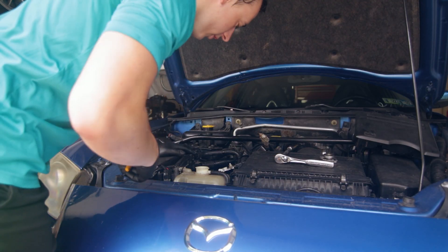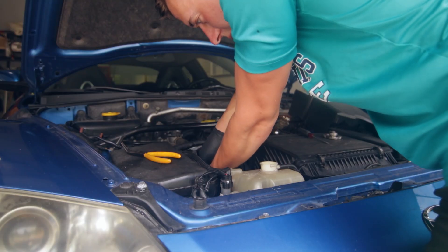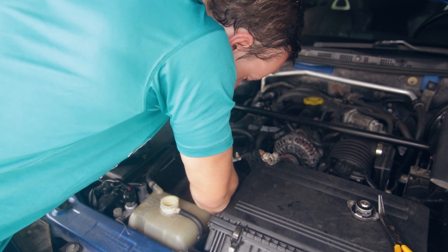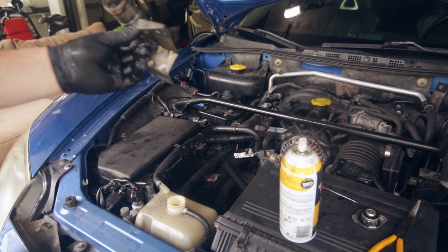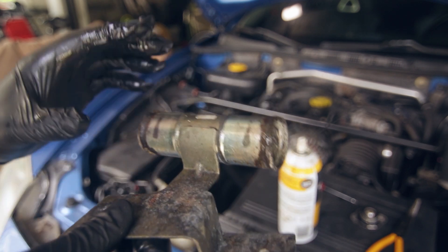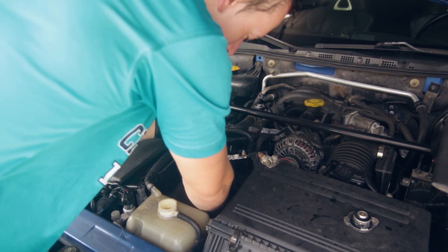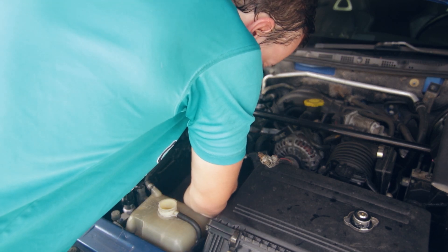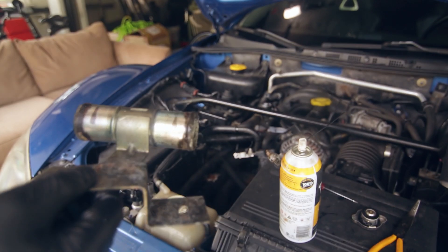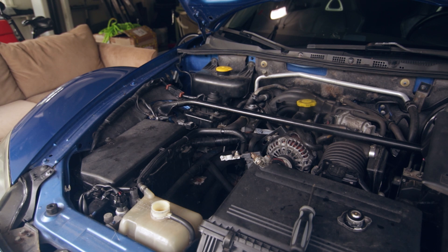Now we've got to take out that piece. I'm going to spray it down, take off the hose clips, take out the bolt, and then it should come right out. Got the piece out — it's a little bit crusty but this is the piece we're replacing. The kit comes with hose clamps, so take those old clamps off. Slip the new piece in with the sensor facing out, throw it in between those hoses, and tighten down the hose clamps — it has to be tight. I have blown the adapter off before because it wasn't tight enough, and that is not a good time.